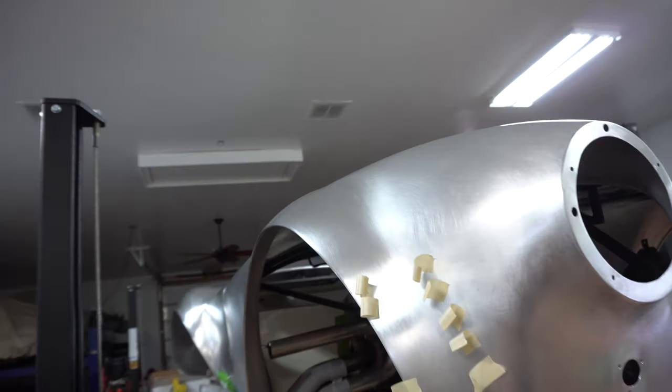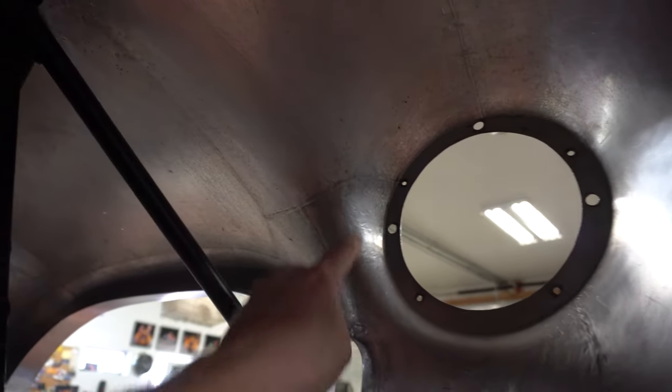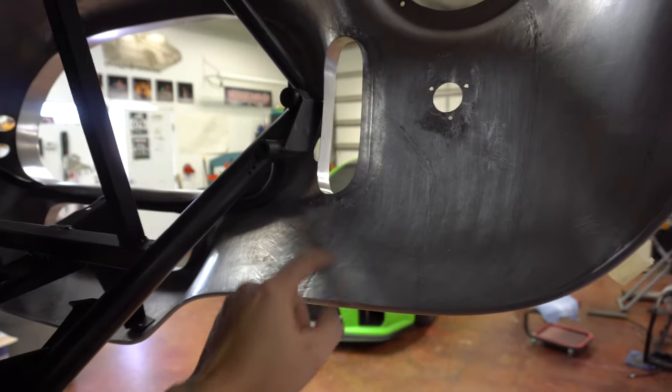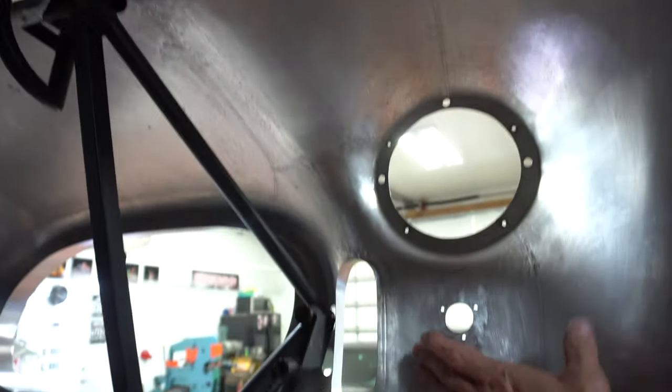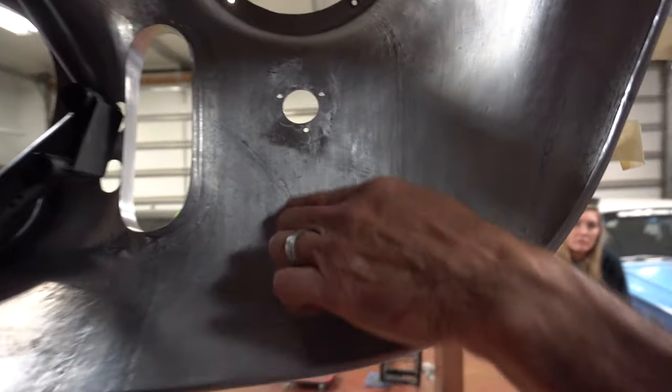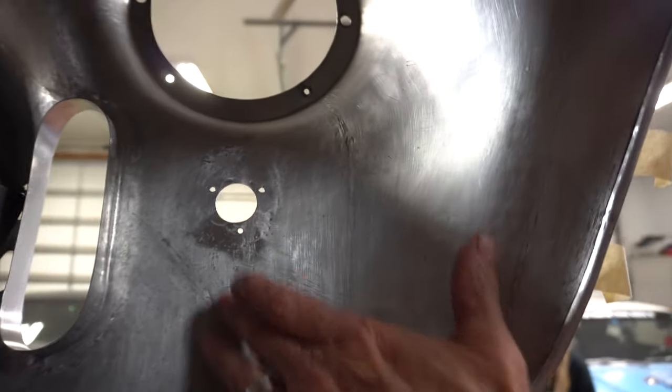You can see a seam running along the body - there's an outer piece, then part of the top of the fenders is a piece, and even the sections coming up here are all separate pieces that have been worked and built. Here's a piece, piece, piece - all pieces that get welded and smoothed in. With gas welding you get full penetration, then hammer and dolly it, bring it back out. This hasn't been ground - it's hammer-worked, filed, cleaned, then the outside sanded with a DA.